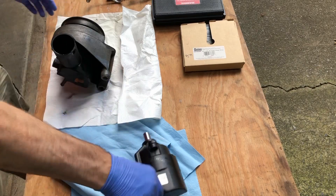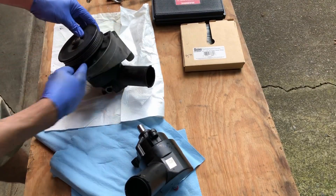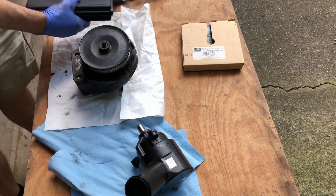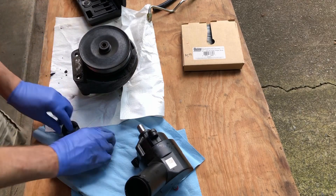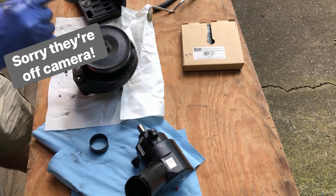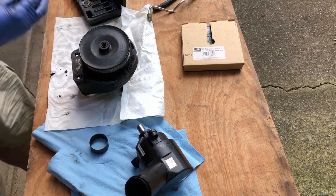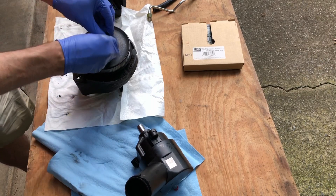As you can see, there are bolts under here that hold the bracket on, so the first thing we need to do is get this pulley out of the way — that's where our pulley kit comes in. You've got the rings here, and you'll see there are different widths. Your large width goes underneath the lip on the pulley like so, and this ring keeps it from coming off so you can pull up on it.